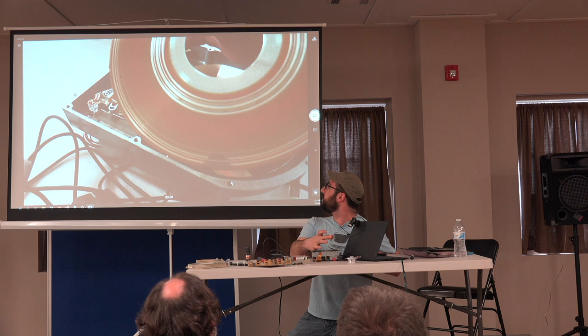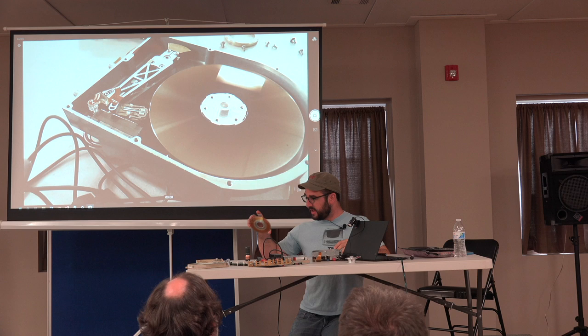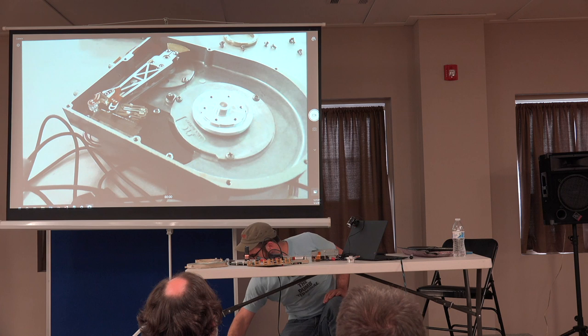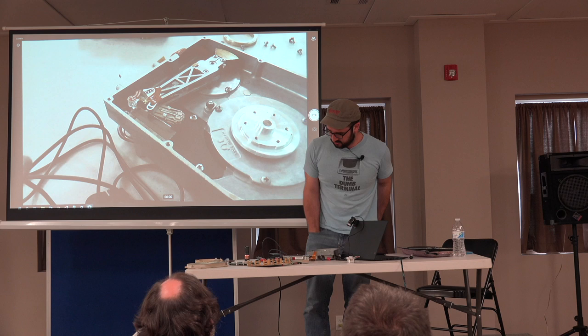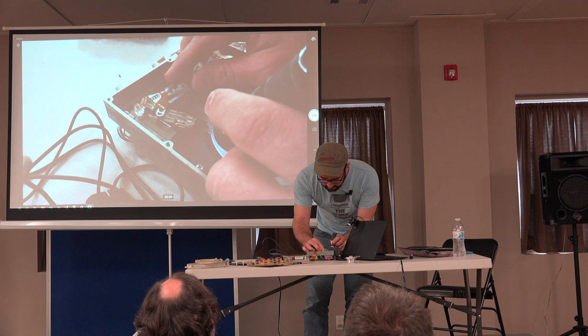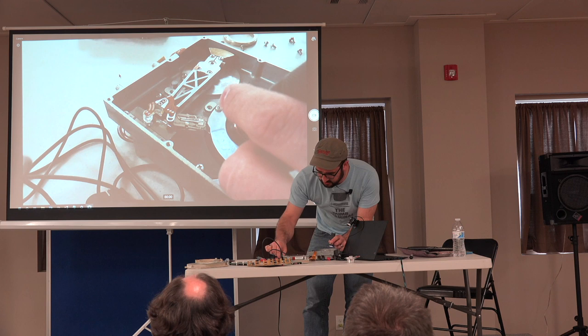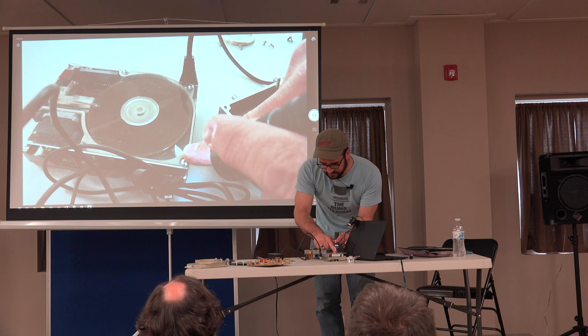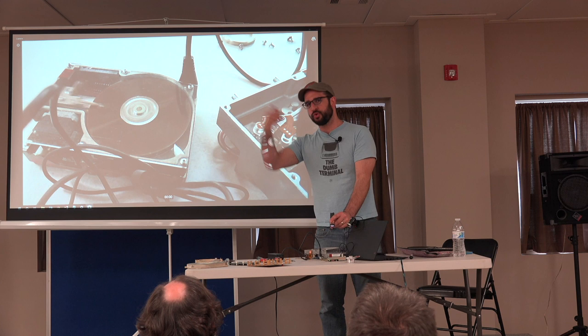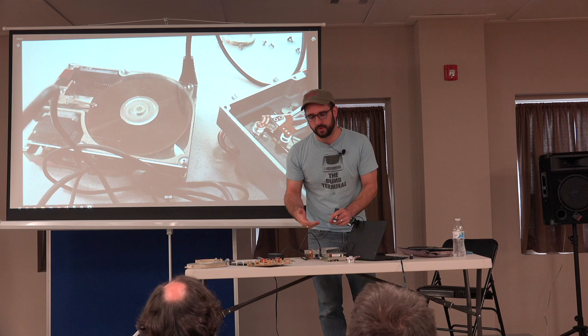They've turned into dust and been collected by the, there's a filter inside of these drives that helps to keep the disc clean. You can see it down here. No, maybe you can't because it's too dark. There's a filter. There, that exists too. There's another pressure regulator thing, but this inside of the disc, you can see it on this MiniScribe drive as well. You can see the filter right here, and so as the air is being pushed around by the disc platters, it gets pushed through the filter. So any incidental junk that gets in there is hypothetically collected before it crashes a disc head.